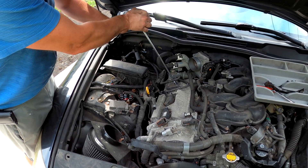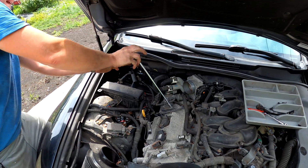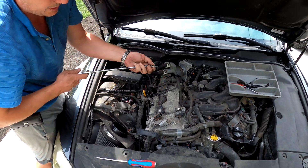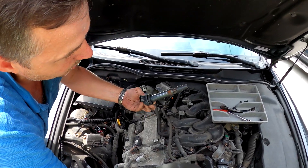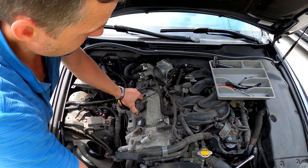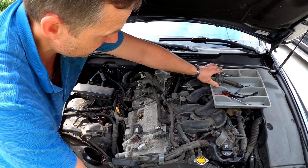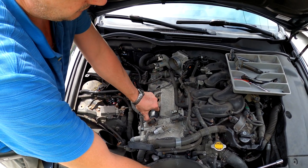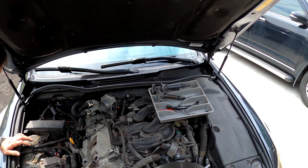That ticking was from a spring. Look at this — rusty as well. This one has probably never been removed. Another thing: when you assemble back, put some little grease on it. That's the ignition coil — it creates high voltage. It's rusty, little rust corrosion there. This is number two — see, it's got a little oil, looks like it's leaking somewhere. It's not good. And this is number three — one, three, and five. This new one's got a little dust on it because it's brand new.